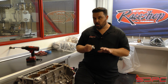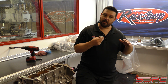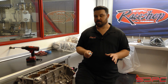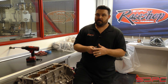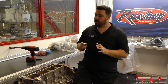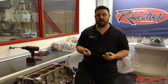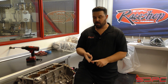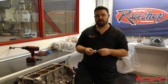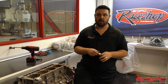To cover it quickly: when you're putting a Gen 4 engine in a vehicle that originally came with a Gen 3 LS, the easiest way is to not try to convert the computer and wiring system to match the engine — that ends up with electrical gremlins, it's very expensive, it's a nightmare. For instance, a '98 to '02 Firebird: you're going to keep the LS1 PCM and wiring harness, put the LS3 engine in, convert a few sensors and signals, then retune the computer. Easiest, simplest, and cheapest way to do it.